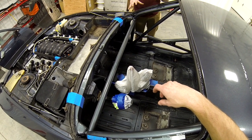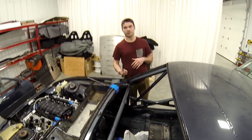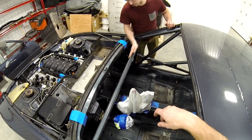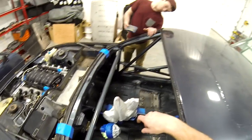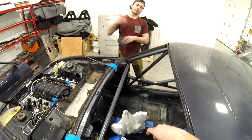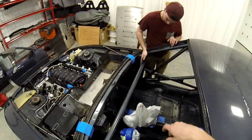So that's obviously an issue with painting these cages, the rounded surfaces and difficult areas to reach. Typically, sometimes a rattle can actually ends up working better. You can get a better paint job because you can get to places you can't normally get to with your gun, once you have your air fittings and stuff on the bottom of your gun. I'm gonna go get the vacuum.